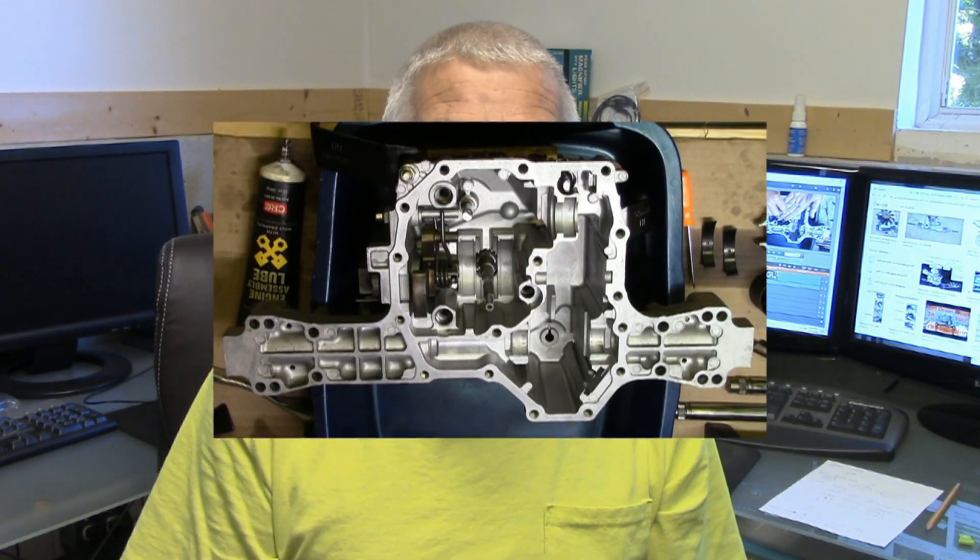I want to let you know that if I would have left that pin in there, within minutes of running that tractor I would have destroyed it and would have been looking at another transmission. There's a lot of good information in here — I've added some info about the swash plate. You can identify which way you want to flip it depending on what tractor it may have come out of. I hope you find that information, or there might be something else in there that helps you put yours back together properly.